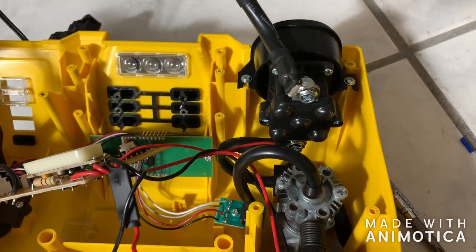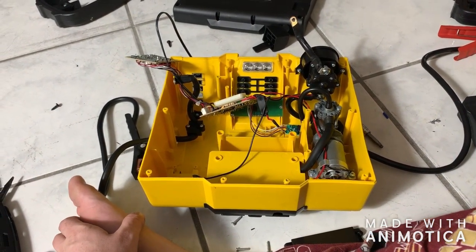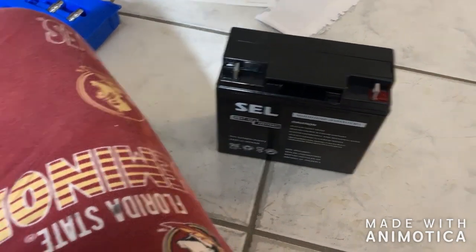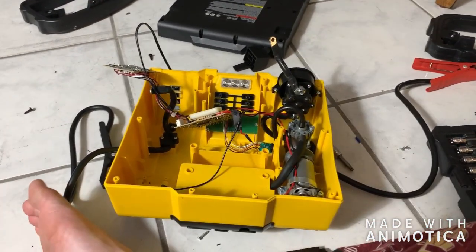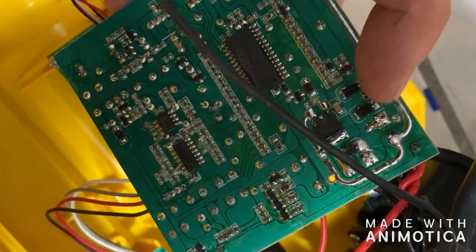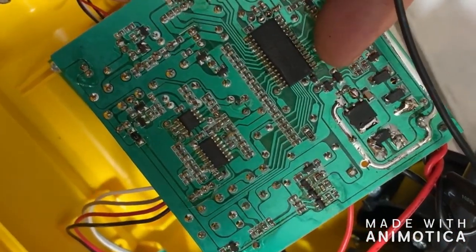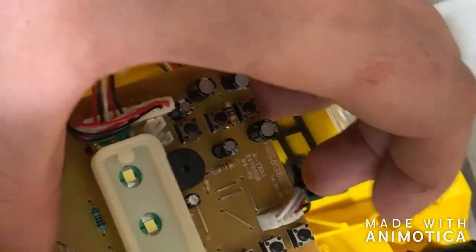And there's this nice switch. Overall I'm pretty impressed — it looks better than I thought on the inside and I understand how it works a bit better now. I'll retract my earlier statement that all the power goes through that resistor when charging the battery. I don't think it actually does — I think it's involved when the battery is fully charged, because there are these two MOSFET components, and that's controlled by the microcontroller. I'll assume they did things right.